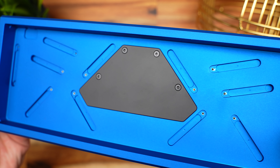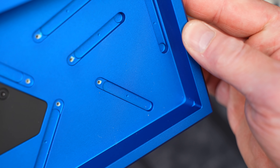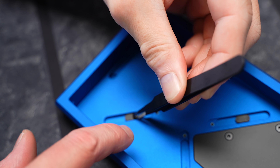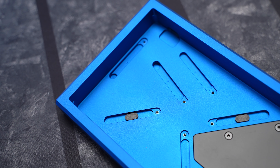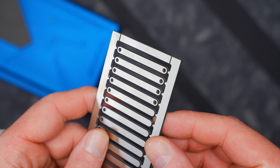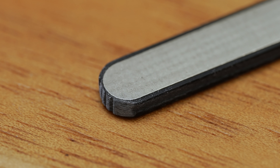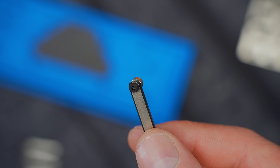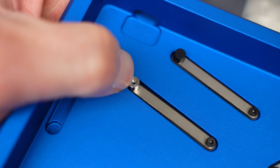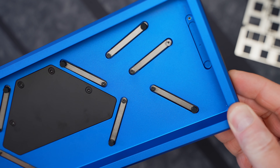Inside the case, you have a center-mounted internal brass weight that's Cerakoted in black. You also see little channels that will be home to our leaf springs — and therein lies the primary unique feature of this board: the mounting system. First, we apply the poron pads to the channels, going in the center of the channels and ignoring the outer two most channels. Those will only be used in builds where people are using their own PCBs that may not have mounting points that line up with the ones provided. We have a sheet of leaf springs — these are FR4 as well. You snap them out of their frame and then file or clip the rough edges to make them smooth. Four of these have a hole on each side and will be used to mount the standoffs. We build two leaves with standoffs and then eight leaves with a rubber bumper. When you're done, you're left with a little bounce in each leaf spring.